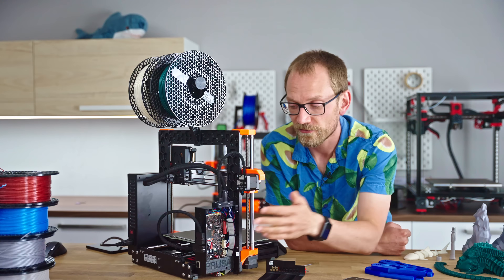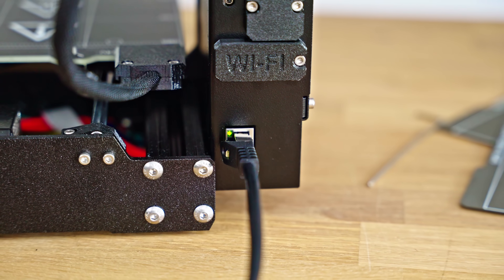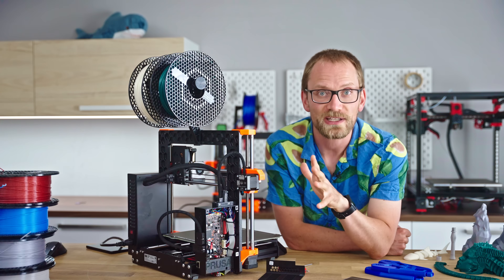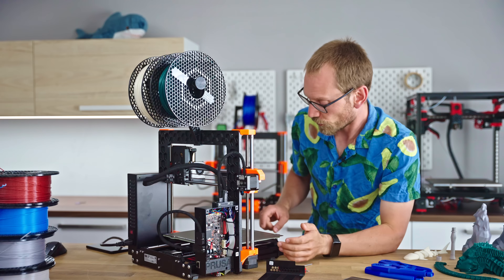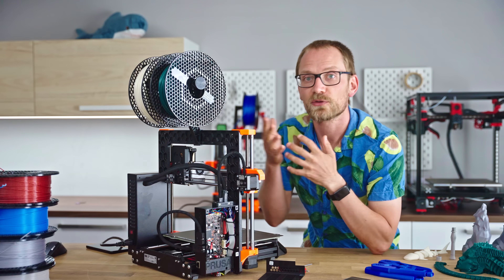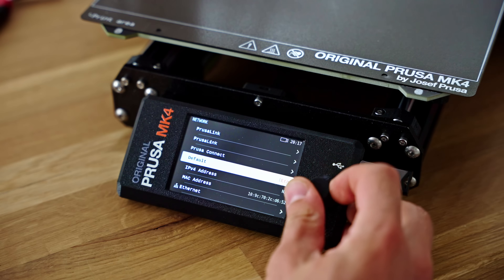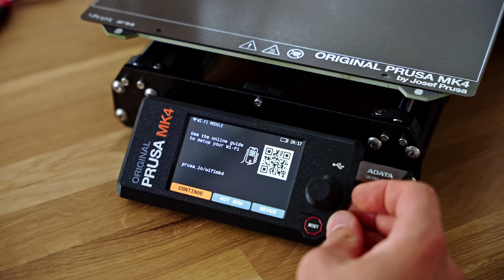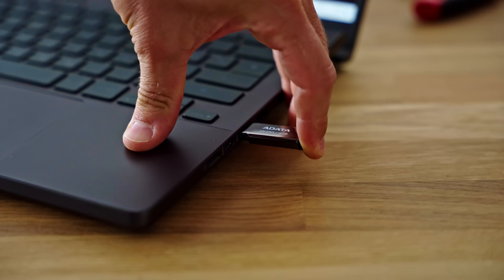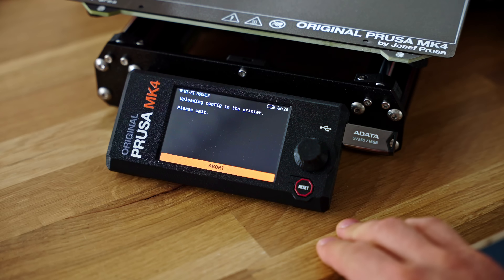I do appreciate the physical Ethernet port — it tends to be a lot more reliable than WiFi and is also heaps easier to set up: plug in and you're ready to go. Especially since the WiFi setup on the Mark IV is pretty inelegant. Typically, you just connect to WiFi directly from the machine's screen, or use one-touch WPS, or connect to the machine's hotspot with your phone. On the Mark IV, you instead open a help article on your phone, tell the Mark IV to generate a config file on the USB drive, take that drive over to a computer, edit the file with your WiFi name and password, and plug it back in. It works, but...